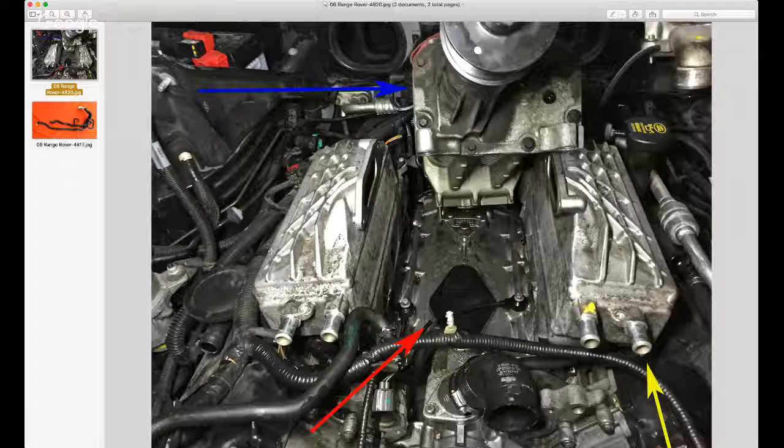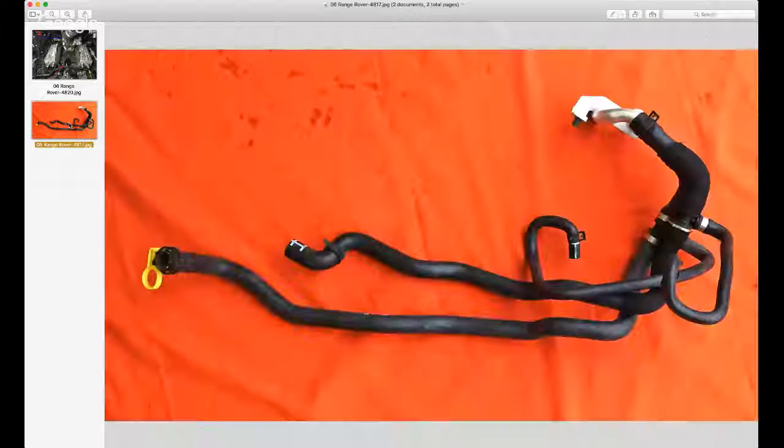So as air is being blown into the engine, it heats up, and it's cooled actually by engine coolant, which is warm, but it's obviously cooler than the temperature of the air. And the intercooler cools the charged air down, so it densifies the air and it gives the engine more power. So it's a performance enhancement, but again, there's another number of coolant hoses, so it adds a lot of complexity to the engine. And while we're looking at pictures, this is the hose we replaced.